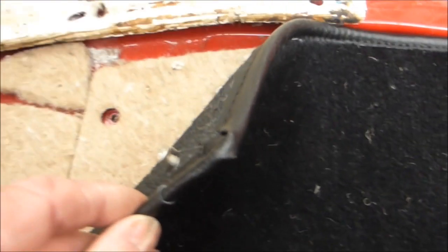Here's a tip that works for me: I've used these very short stumpy studs, put them exactly where I want. You can see where the stud is and where I'm going to punch out for the seat runners. By pressing on the carpet, the studs push into the canvas, so I turn it over and I've got all the positions of where the clips are and where I'm going to punch out. Just make sure you don't mix them up.